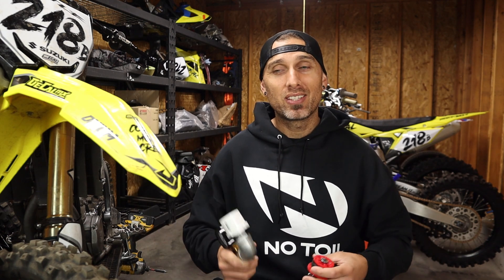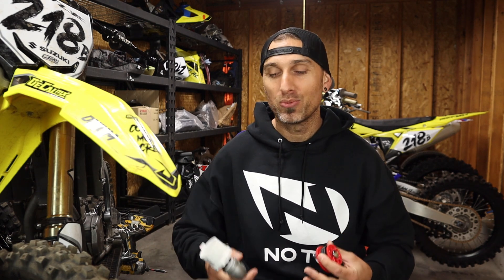A lot of you guys saw the last RM250 video. I pretty much bought this used, spruced it up, jetted it, and was just really excited to ride it. I waited a whole year to do it. Anyway, on the first ride the bike blew up. We're gonna do a leak down test and see if we can find some air leaks. I think we have an air leak because the jetting was perfect and the bike still blew. There's also a good chance there was already some damage inside the engine — the previous owner warned me it was starting to run a little tight.